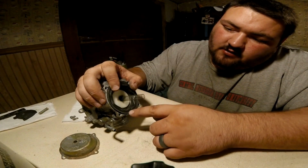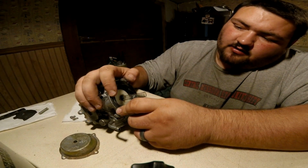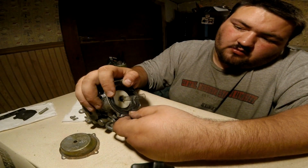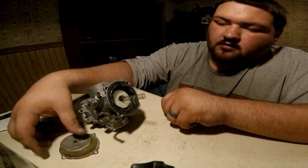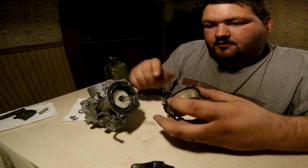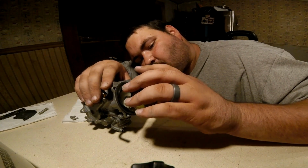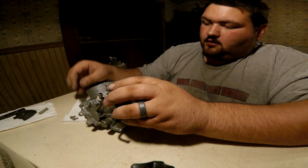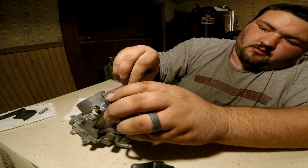And kind of take your gasket here, whatever it is, it's rubber. Make sure it comes all the way out there. It's going to make a good seal. It's got a little rubber line in there that it sits in, and it's metal line there. So then you take your cap, and you look there, and there's that. I'll line the spring up with that little nipple, and then take your bolts with the washers, put them in there.